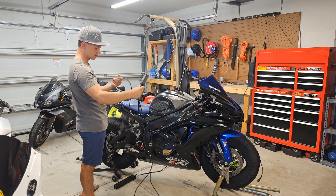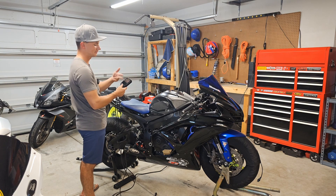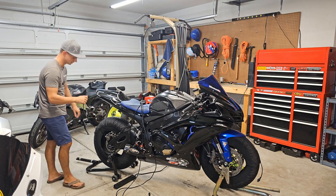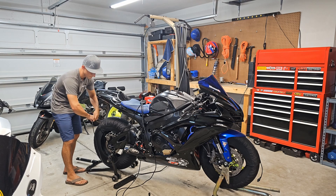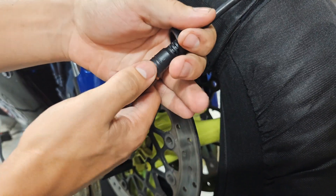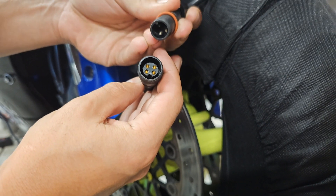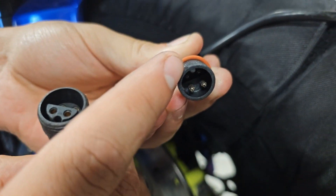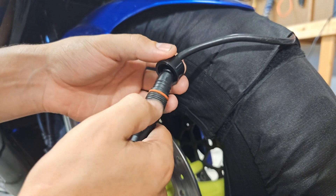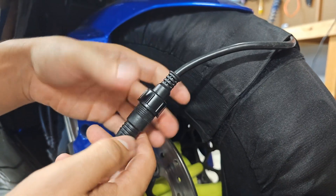Since it's one controller, the front wire goes to the front tire and the rear to the rear — they'd work on either, but it's easiest to read the labels. Your power cord comes out the middle. The connector on the Vortex has a little screw cap with plastic threads and an o-ring inside. There are two levels on the connector — look for the little dent and align it properly. Always bottom it out first before threading the cap, otherwise you'll rip the threads apart. Thread just enough so it doesn't come undone and you're good.